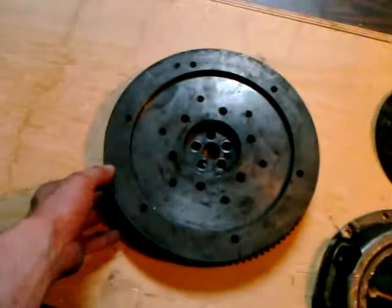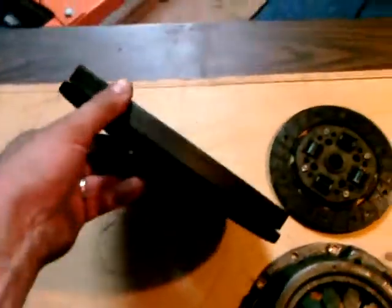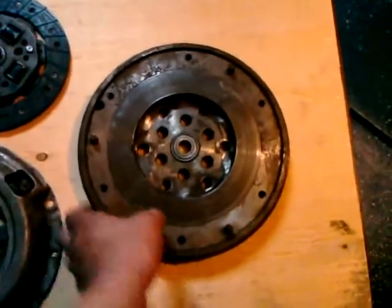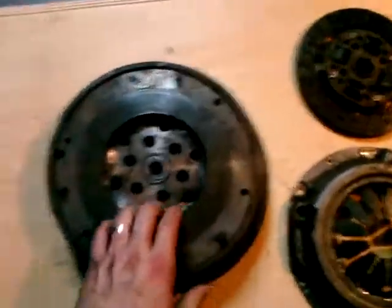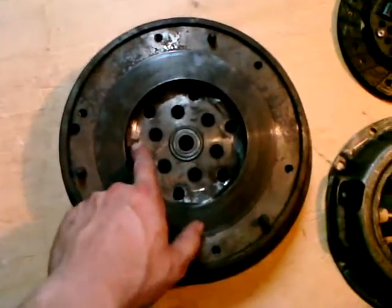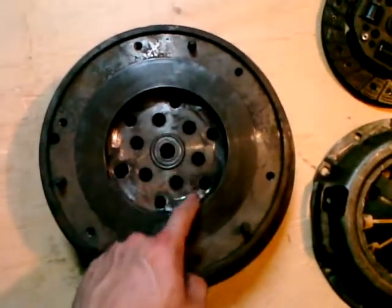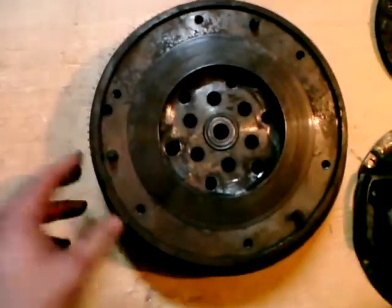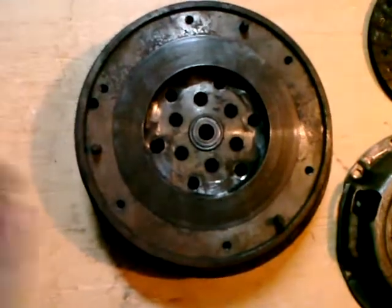Yes, flywheels plural. This is the Yanmar flywheel, and you can see it's quite thick, pretty heavy. It weighs about twice what the Festiva flywheel weighs. And these two guys, when this car was originally put together, these were just bolted together, and this bolt hole pattern right here, I believe, is just hand laid out, punched, and drilled on a drill press. It's not all that precise.